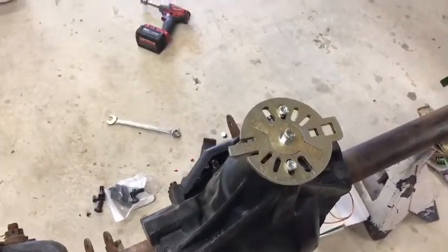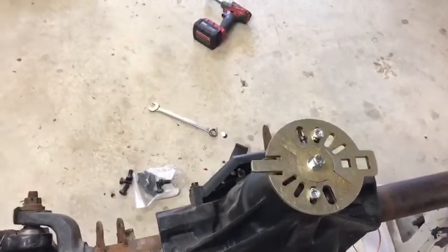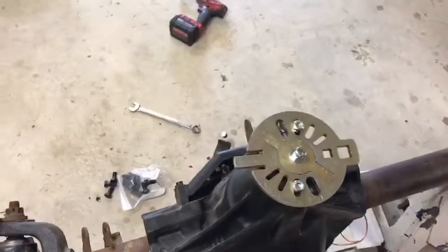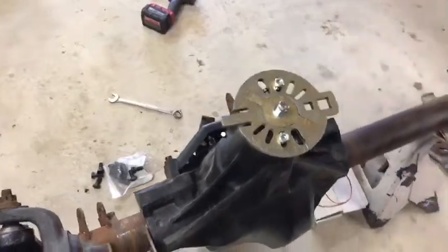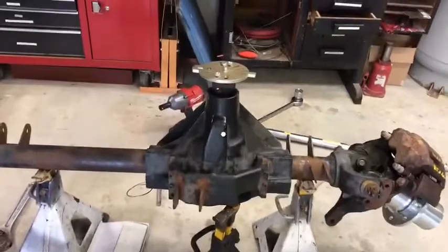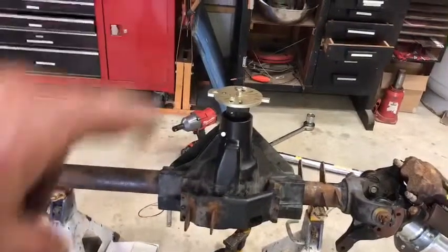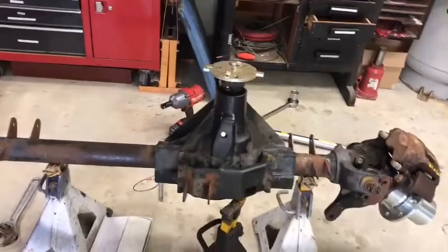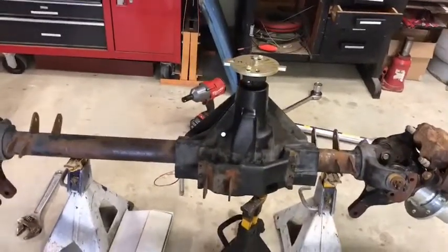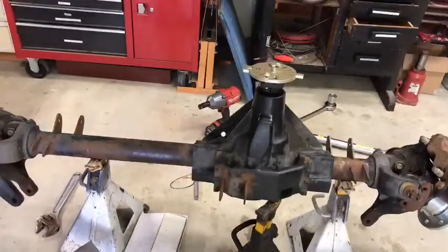I still have to take it apart and take off all my setup bearings and cones. I need to drill the hole for the ARB into the housing and do a couple more little things. When I put it together for the final time, I need to make sure I get the pinion nut torqued down to the correct 14 or 18 inch-pounds of turning, and I want to see that little hitch that's in there go away.